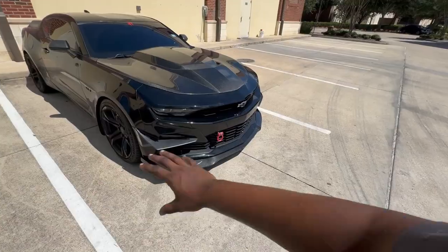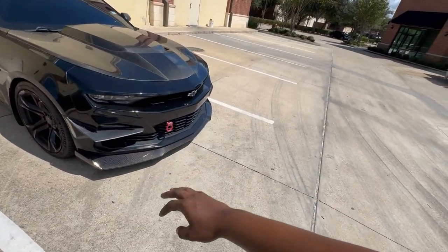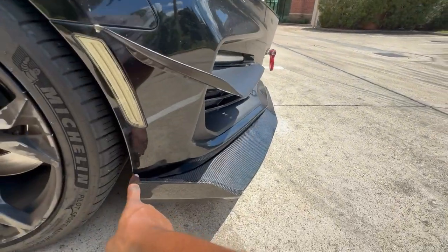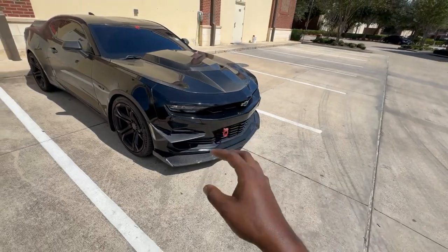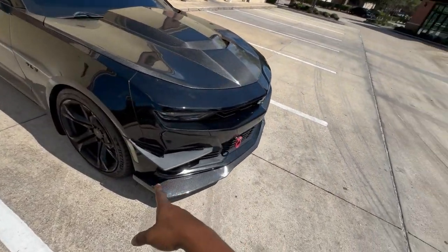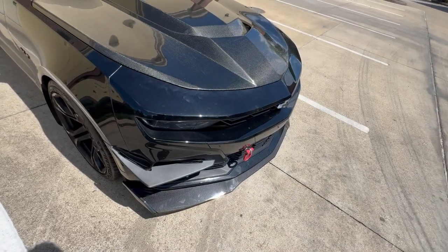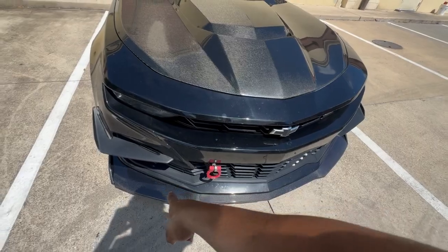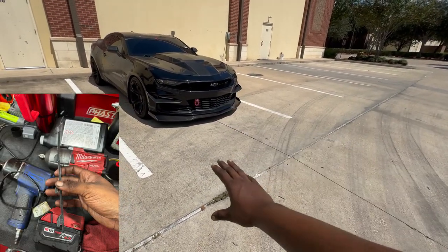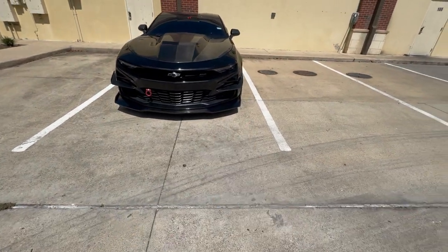One thing I want to mention — if you have a 1LE, there are going to be about ten 8mm bolts that go through the entire front splitter, and about five rivets through the front splitter as well. Then there's a rivet on each side that you can only get out by going through the fender liner. Once you get those drilled out, you're going to have to apply mad pressure, pulling down and toward yourself, because there's a bracket in that area the front splitter slides into, and that bracket holds it in place.